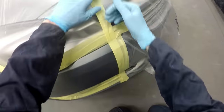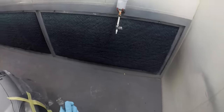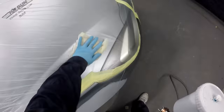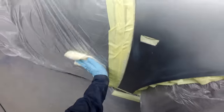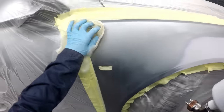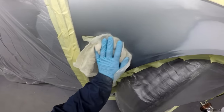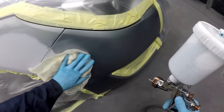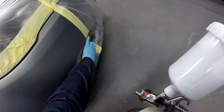It's just got a little air gap to give a nice false edge. One of the most important things for me — and a lot of you have commented asking how do you get a job that clean — it is all about preparation and effort. Making sure your car is clean, well sheeted, your booth is working well, and also the tack rag. Your tack rag is probably one of the most underutilised pieces of kit you've got. I tack rag the sheeting around the area just to make sure no dust has settled anywhere near where we're going to paint.